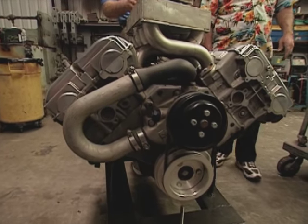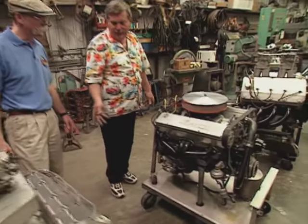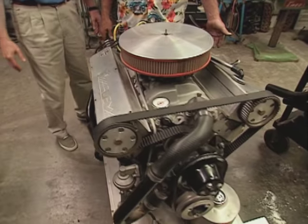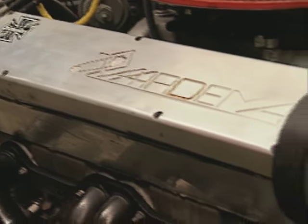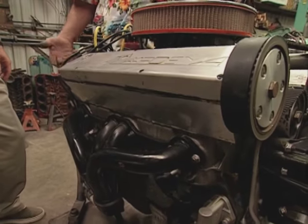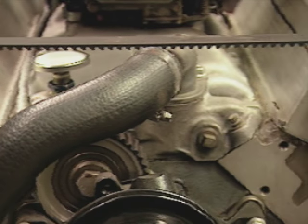So how did you go from here to somewhere else? Right. Once we did that, we said, well, we could put a cam on a stock Chevrolet. Let's make an overhead cam Chevrolet. So we took a small block Chevrolet, bolted this cam box right on top of the head using the rocker studs, made two cams actually, put a belt on it, and we've built 50 of them so far.